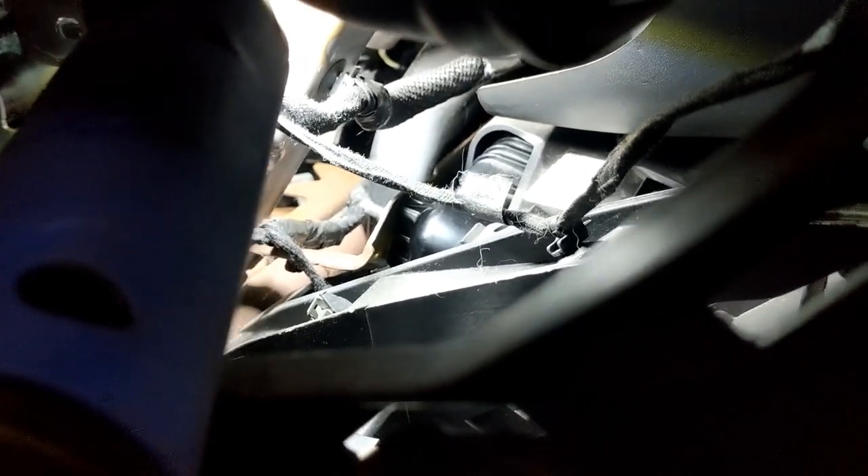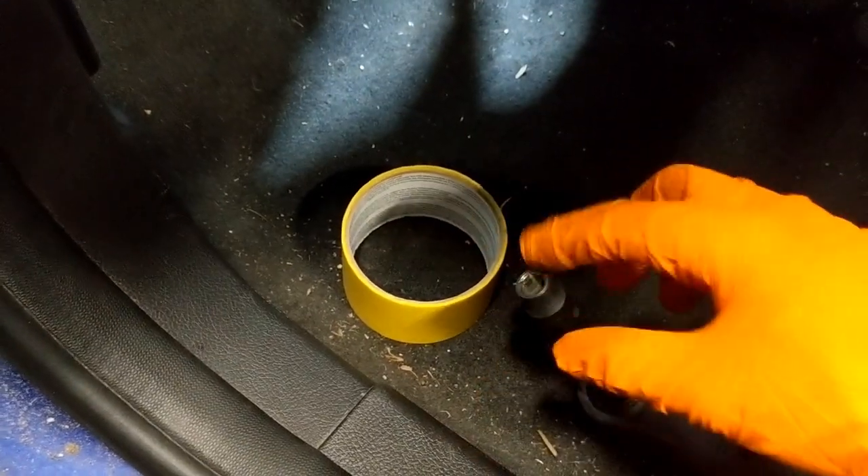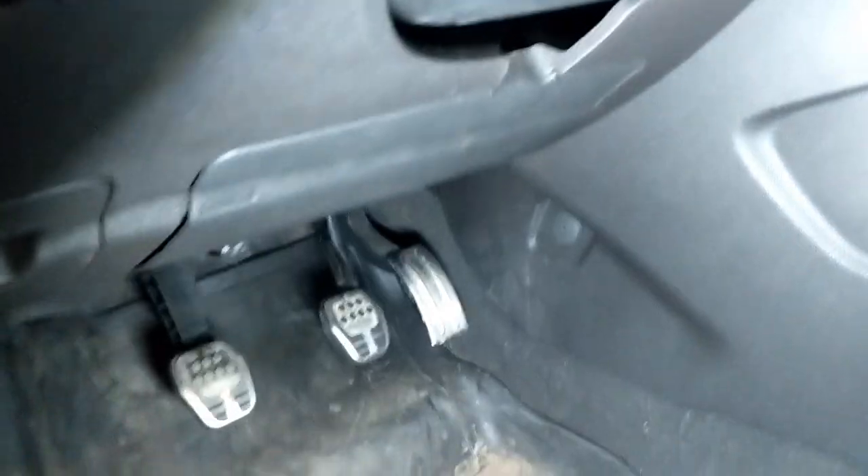You might have a hard time getting the airbag nuts in here — it's right there in the center. You have to go in behind here up to the clutch pedal and press the clutch pedal at the same time while getting the ratchet in there. An electric ratchet helps out a lot. Just put some tape on the socket to hold the nut, then do the same thing with the other side — you'll be looking up through there, get the stud lined up, and press your button.